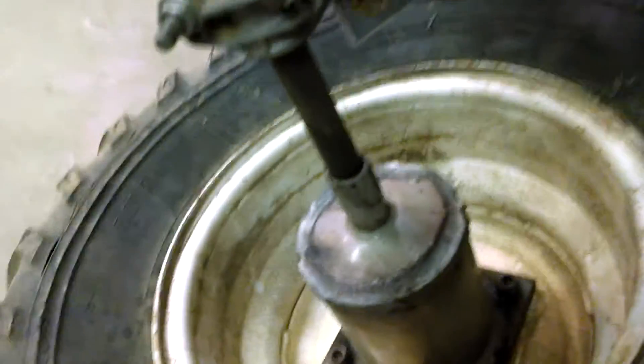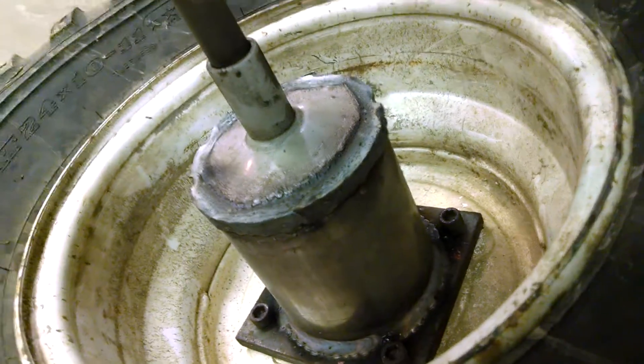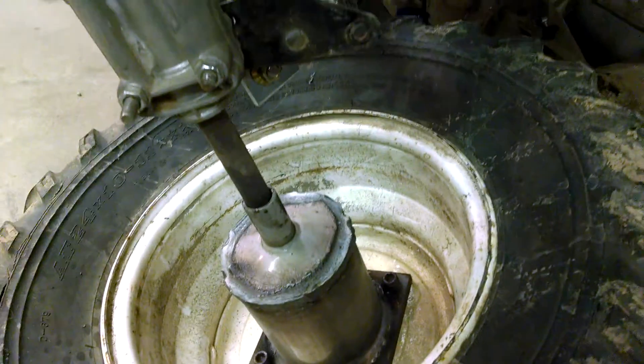It's kind of dark to see, but this is the other steering knuckle — tie rods are behind the axle. The rear end is still the FNR; I've got this link made up for now, but it's going to get a different one when I get the Peerless mounted in here. The hubs are just the lawnmower wheel welded to a piece of pipe to a plate, used as the hub to accommodate the ATV wheels.